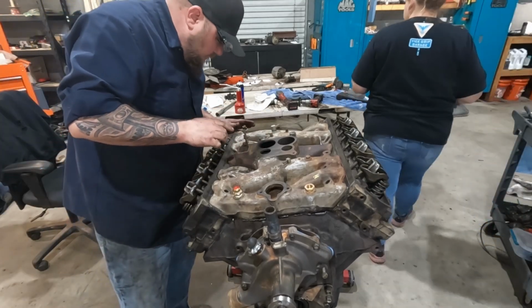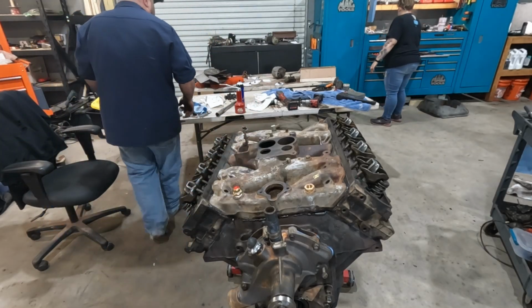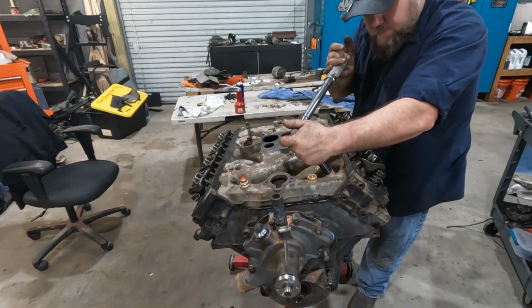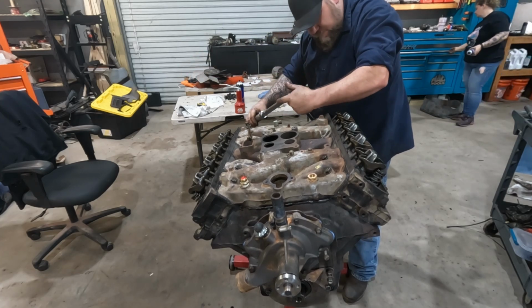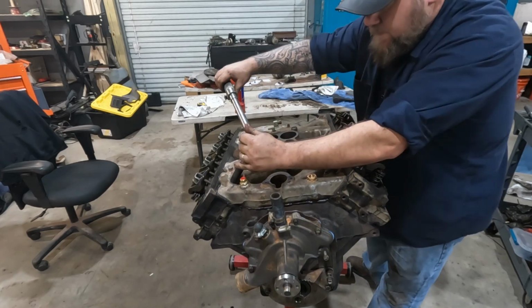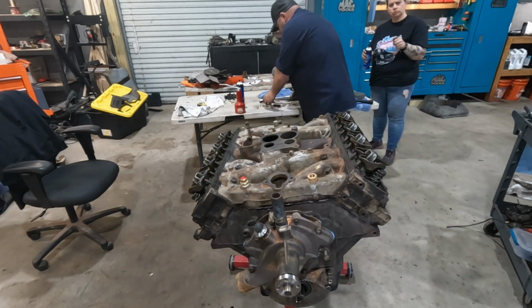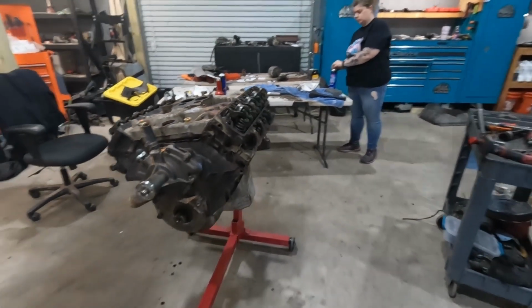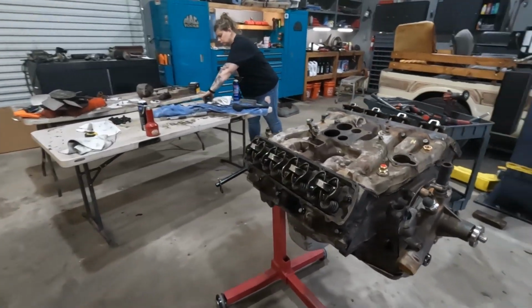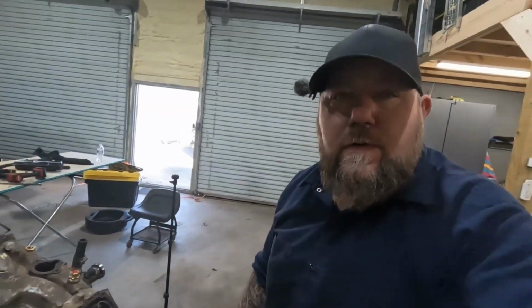All right. Silicone on the inside and outside of the gasket, which goes against everything I'm used to, but we're going to run with it. All right. Looks like an engine again. We are going to slam the valve covers on real quick and tape a bunch of stuff off, paint this up, and I think that's going to be it for today. And yeah, we're doing Chevy Orange.